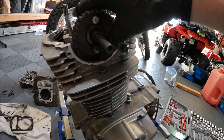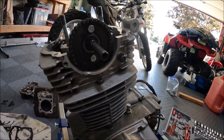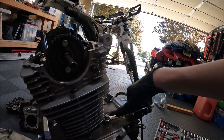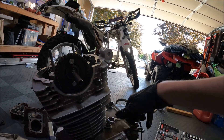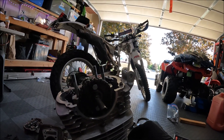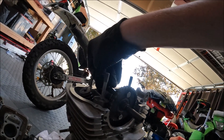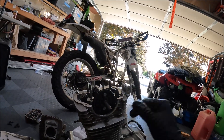If you want to not have to take these two screws off and still load the cam in, bring the cam in so the chain comes from the back side and slips over. Then reset your tensioner: take this bolt out, push it down — it'll pop free — then put it back on. Feel the tension and tighten that back down. After this we are going to load our rocker arms on. The only thing with those is you need to hold the rockers with your fingers while you put it down, otherwise it'll bind. Make sure you have this bearing and the piece in the hole or it won't go down. I usually hold my thumb right here while loading it to keep tension on there.